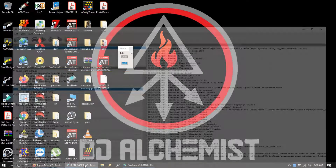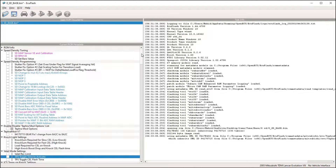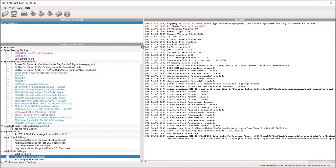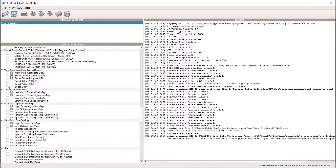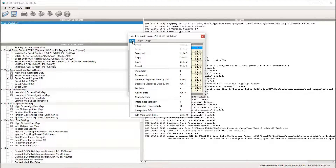Those are basically the basics of changing the tune. Afterwards, stay off boost and make sure everything is running correctly. I'd lower the wastegate boost a little lower, set everything a little richer, and set all timing lower too. Then slowly increase and see what the car likes. It will make your car run a lot smoother. I love the SD format for this — it's not standalone but it's very, very good. One other thing: when doing your boost on SD, you need to change the scaling of the boost tables according to your MAP sensor as well, since that's the only thing reading boost.